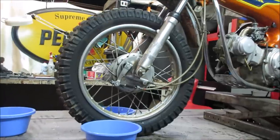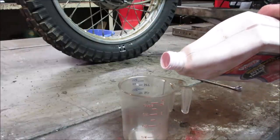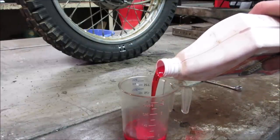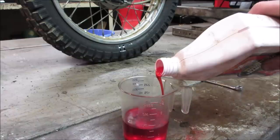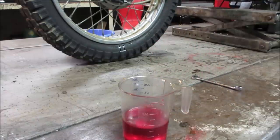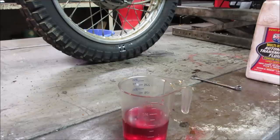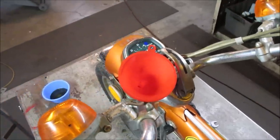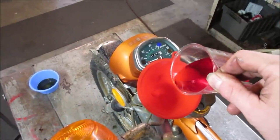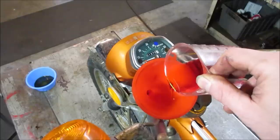All right, let's go get that in there. And we'll button that up. Maybe we'll get that front wheel off of there and take a look at what we've got going on for brakes. I tell you, that old stuff smells like sour grapes, like old gear oil. And that's 3. Kind of split the difference in there. Go with right about, do you call that 3.7? From your view, it probably looks like 4. If I find it has a crappy ride afterwards, like not enough dampening, we'll just change it out again. It'd be good to flush it anyway. Let that splash through the system. See if we can make a mess out of this. Kind of want to not let it get airlocked. You know, you fill the funnel up too quick and it bubbles back. Yeah, like that.